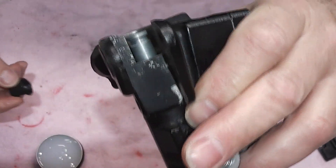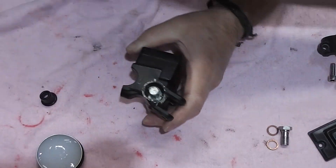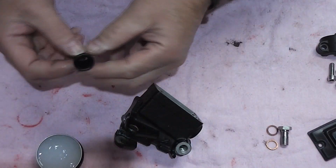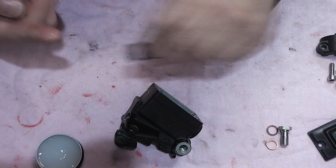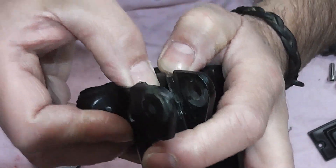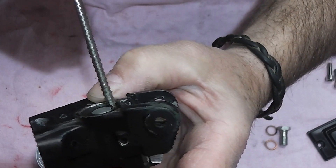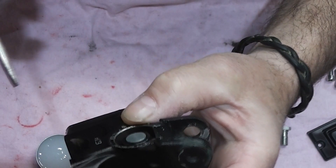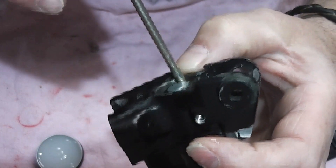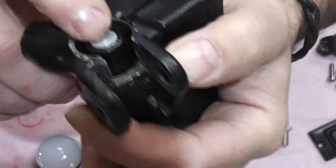The next thing is your rubber seal. I'm going to put a bit of silicone on the end of that because these rubber seals can be a little bit of a pain to get into place. We've got to get that in there and put it over the head of the push rod. When you push that down, that seal is supposed to stop ingress of water and moisture. Make sure without puncturing it with a screwdriver that the seal is all the way bottomed out in that groove, pushed right down tight up to the circlip. Master cylinder assembled — raring to go.